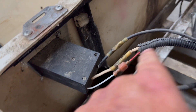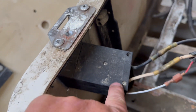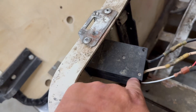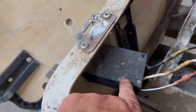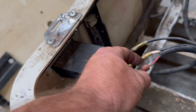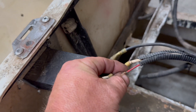What's a reed switch? Well, the reed switch is a safety switch that's built into the factory terminal. So when you plug your stock charger into this, it would break continuity on the reed switch. When it breaks continuity, it would not allow the golf cart to drive any longer because this wire did not have a pack voltage on it.